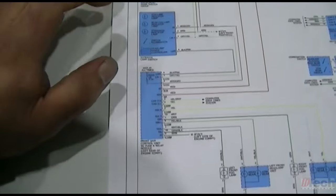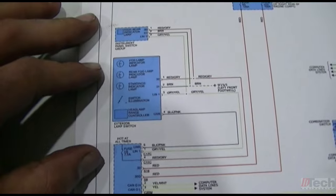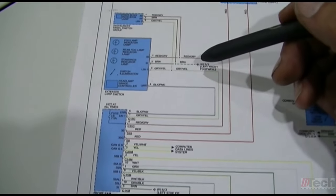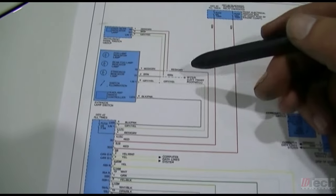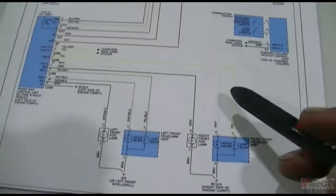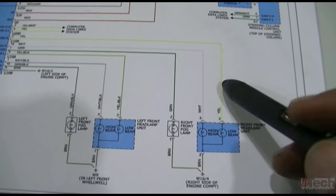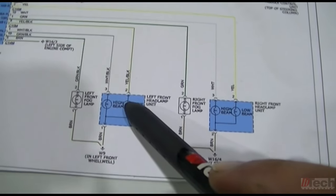Initially, my idea was to look and see what was involved with the actual headlamp switch to see if I can pick up anything off of there to start with the bypass, but unfortunately it is all controlled via the LIN bus, so it's all internal, and then it's just information that's bussed over to the SAM, and nothing can be picked up off of that. So the next thing that I thought about was if I could pick up off of the power feed to the opposite light to control the faulty dead light.